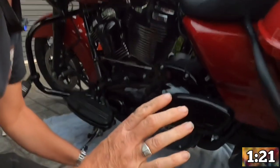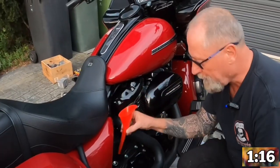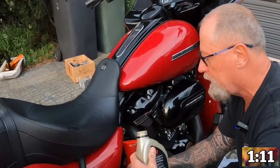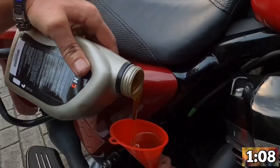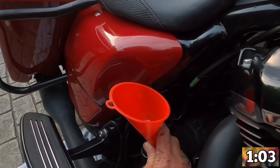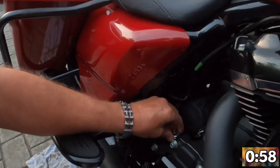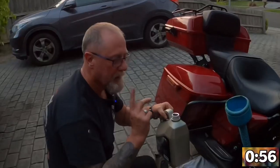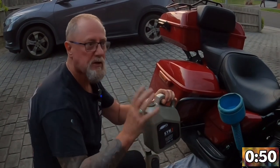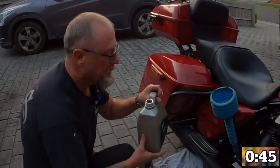All oil drained, that side's done. All we've got to do now is fill up the other two. Small funnel into the transmission — the rest of that quart we used earlier to prime the oil filter. Leave a little bit in there and we'll check it once the engine's been run. Cap back in. Last but not least, 3.78 litres into the engine — drop it all in bar just a smidgen, and then we can check it after the bike's been run and top it up if required.